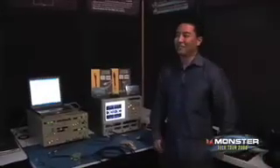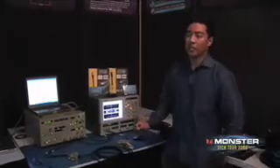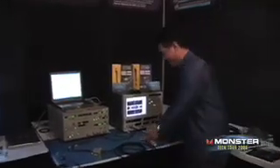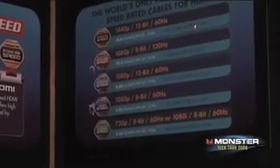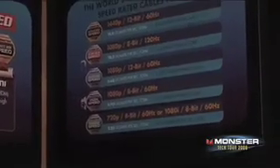So we can probably go even higher. Einstein, what is this cable rated to do? This 4-meter HDMI cable is rated at ultra high speed, which is 10.2 gigabits per second. But let's bump it all the way up to ultimate speed — 14.9 gigabits per second total. At 14.9 gigabits per second, we're at 4.98 gigabits per second per lane. Notice that this one lane is actually greater than the total bandwidth of high speed at 4.95 gigabits per second — that's a major amount of bandwidth; it's like having three high-speed HDMI cables in one cable.